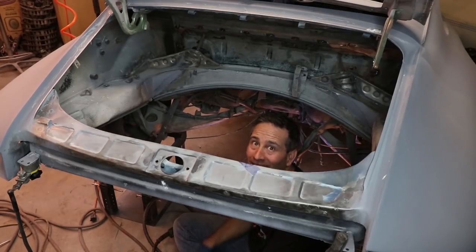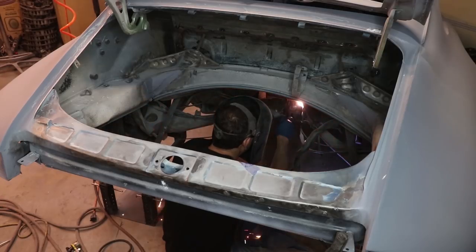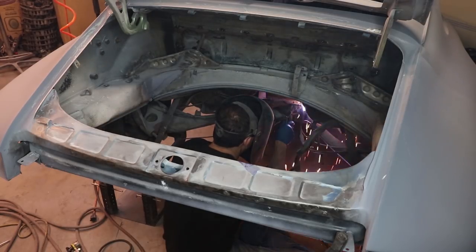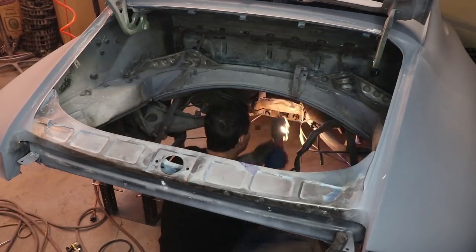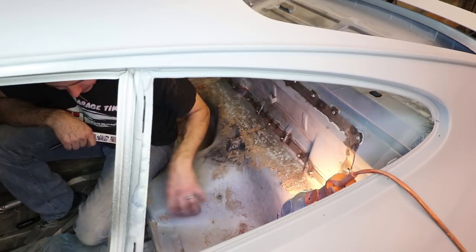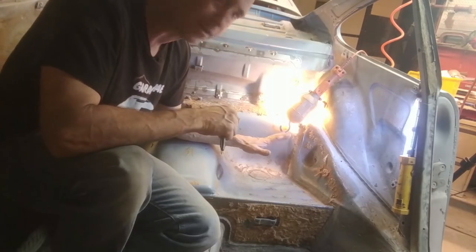I'm about to undo at least an hour's worth of work that I did to put those plates in, but I'm going to cut it off with the plasma cutter pretty close to this lower weld. And then I'm going to cut the seat pans out from inside. I'm going to need to remove a big portion of this seat pan in order to get access to build the box that's going to support the inner trailing arm. I only get one shot at this. I'm going to cut it a little larger than I probably need to, only because I want to reuse the piece. If I cut it twice, then I can't reuse it without splicing it back together.